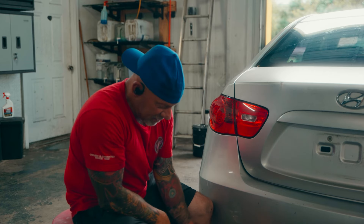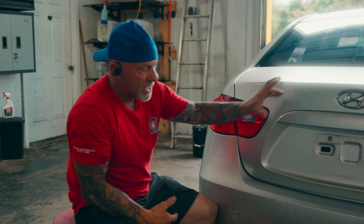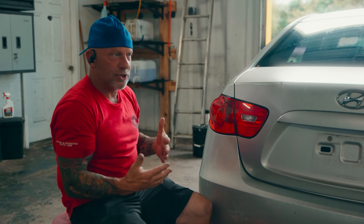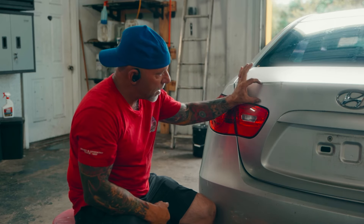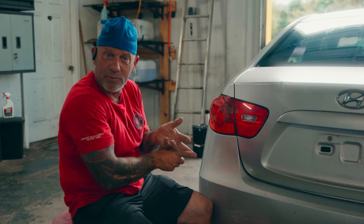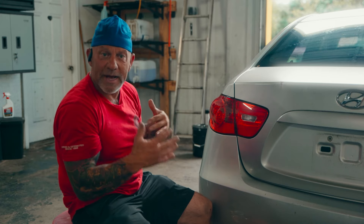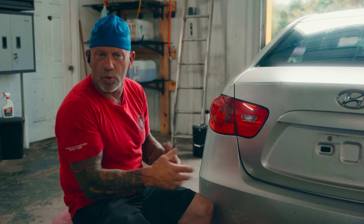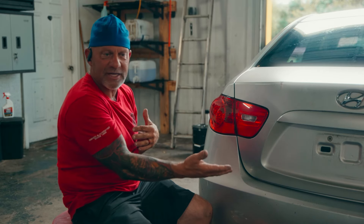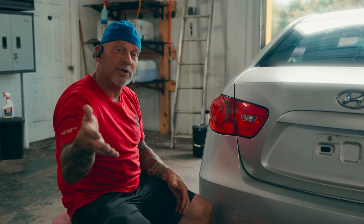Some people have asked, why do you de-badge? Sometimes when you get one that's been neglected and it has some very large lettering, you notice the lettering is going to be discolored — instead of red, it's a Pepto-Bismol pink, and you can't get behind it. What you'd want to do is get a piece of painter's tape, put it on the badge, then take your fishing line behind it so you can hold it level and square, exactly like it was on the paint. Take that off, clean it, buff it, wipe it with alcohol, and then put your emblem back on. Sometimes people take them off because they've knocked one off, or maybe they want to change it from saying Mustang to a Cobra. So there are a few reasons to de-badge, but this is the easiest way, the cheapest way, and a way you can do it without messing anything up at home.